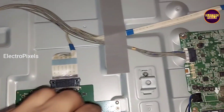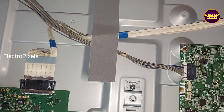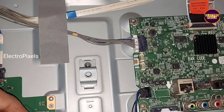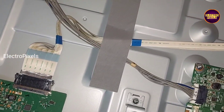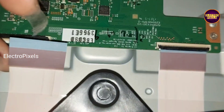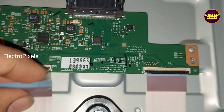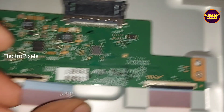So now let us turn off the TV. We are going to mask the left side gate signal tracks. For that, we remove the tape from the right side, then reconnect the right side FFC cable back to the T-con board. Now let us disconnect the left side FFC cable. Like this, we are going to mask the gate signal tracks from the left side, blocking the left side gate signal tracks through this taping method.